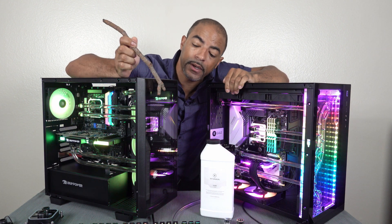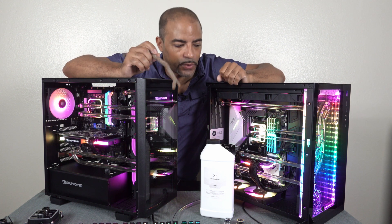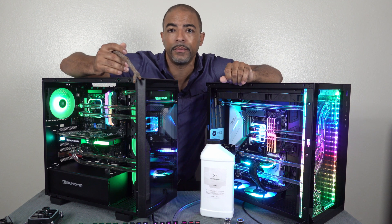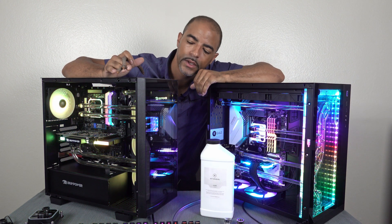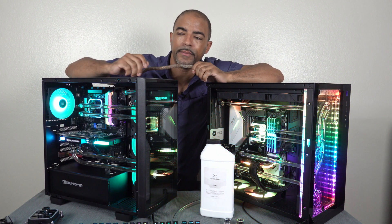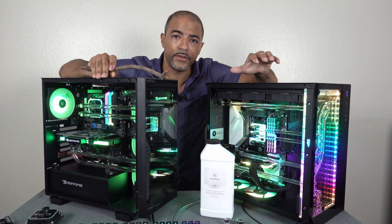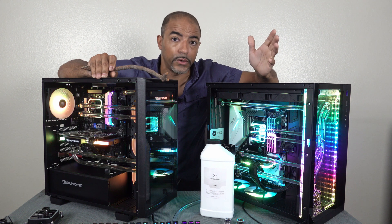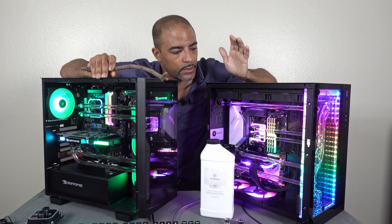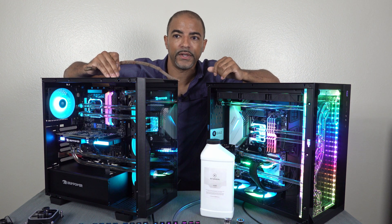In terms of the distro plates, you'll notice the iBuyPower distro plate is pretty bland — straightforward. Meanwhile the EK one is full of all kinds of stuff going on. EK is a water cooling company; iBuyPower is a pre-built PC company. So the EK one is going to be more polished in certain respects, while the iBuyPower one makes more sense on the assembly line — easier to build at a much lower cost and faster rate. For EK, this style does take time to put together and there are more potential points of failure, so they'd definitely have to go through more quality checks.